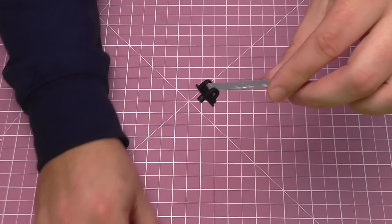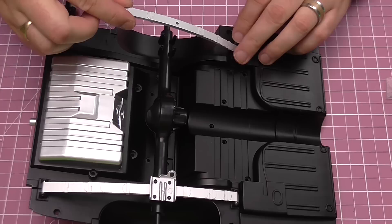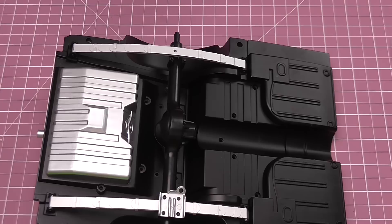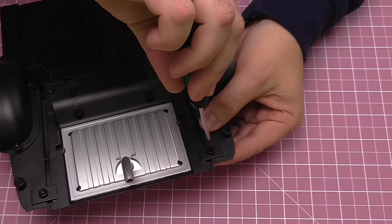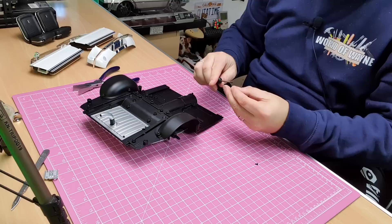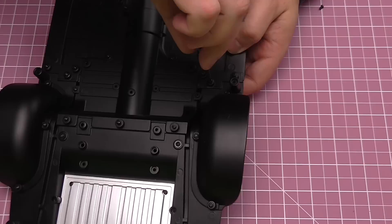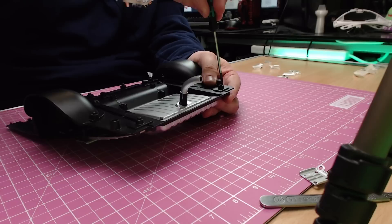That section's in and the pin's nice and flat. Now we're ready to put this underneath the vehicle. Bringing the vehicle over, just like last time make sure you put it in the right way — these points don't fit the same holes, so it only goes in one way. This goes in just like this here on that side, and just like that on the other side. We need to secure these underneath — I'm going to use two MPO1 screws, holding it with my hand. I'm only putting it in enough just to keep it in place, not over-tightening. Put the other MPO1 in the other side, which is just this hole here.